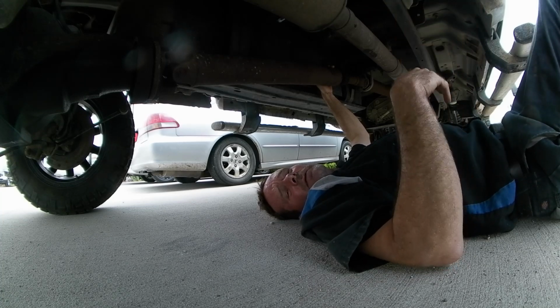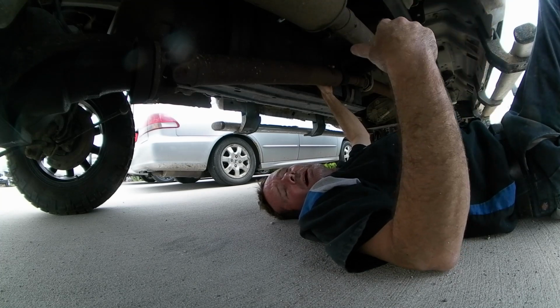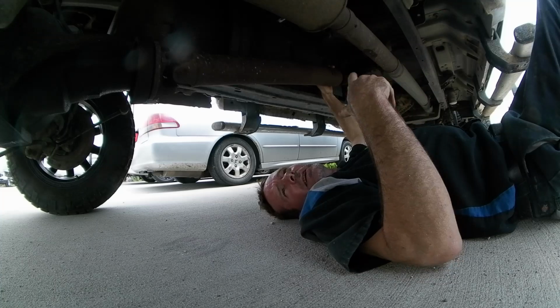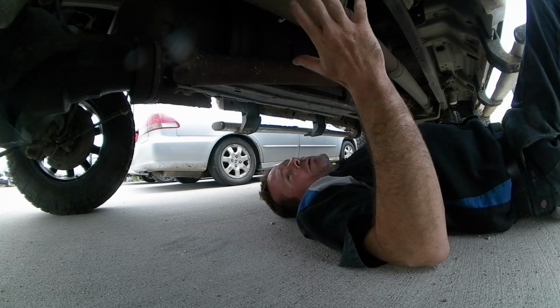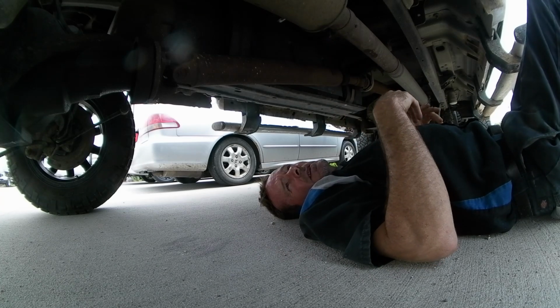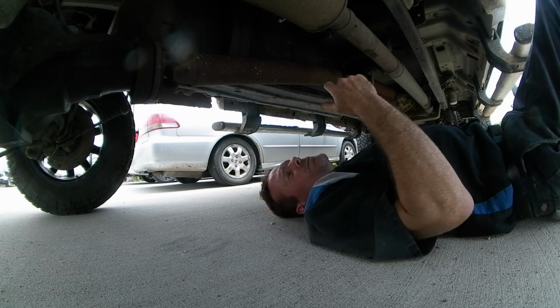If you have lost some, it's really not worth adding to the old fluid, because this rear diff fluid is about $25 a quart. So it's not worth adding to it and diluting it down. You might as well pop the cover off and get a fresh reset and get all fresh fluid in it. We brake clean it out, clean it all out. In a perfect world, a driveline rebuild and a pinion seal and a rear diff service. Or we could just do the U-joint. Either one.